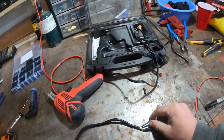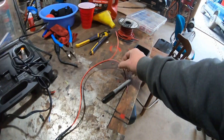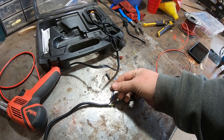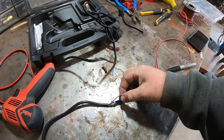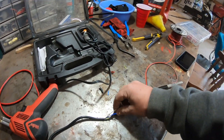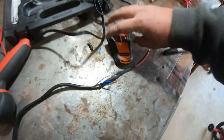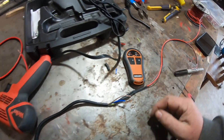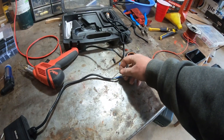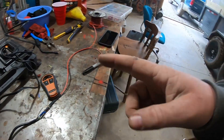Hopefully all that makes sense. I had four wires in here — one was hot, which was yellow with a green stripe, and one was black for ground. So these will run to the battery, simple enough. Now I can't remember which one I decided was up and which was down, so I'll figure that out once I hook it up. I'll go ahead and hook this up to the battery and test it — one of these wires will correspond with these buttons. The controller tells this to send the hot through this wire or that wire depending on which button I press.